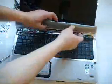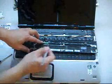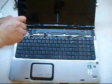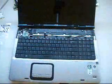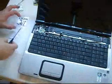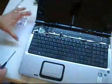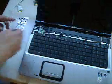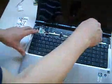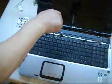This is a Benton spatula I am using right now — very handy. And don't pull it all the way because there is still a flat ribbon connector here that connects to the system board. So remove the keyboard. The front section — I organize its screws on a different tape here. You can see this tip on my website, laptoprepairguide.us, under repair tips — a very, very basic but very convenient tip for anyone who wants to fix any laptop.